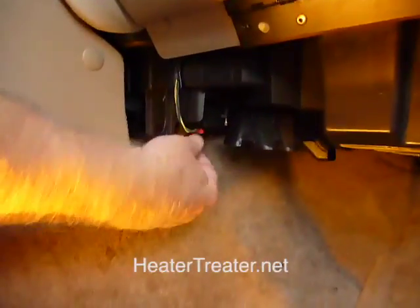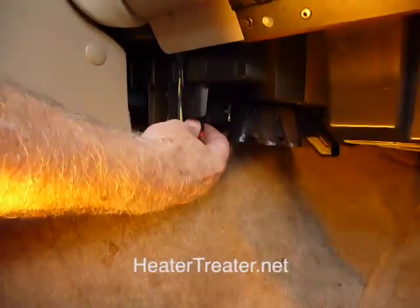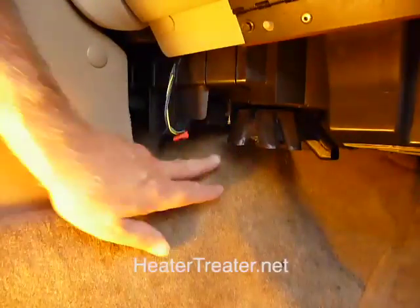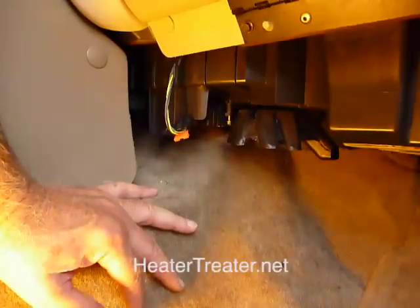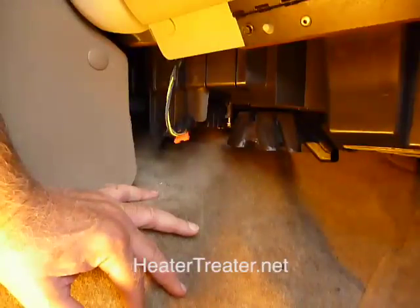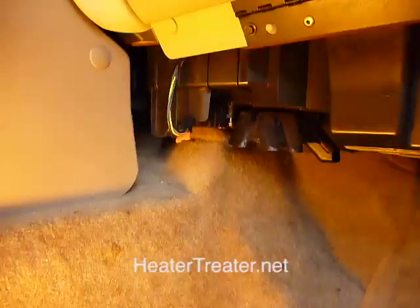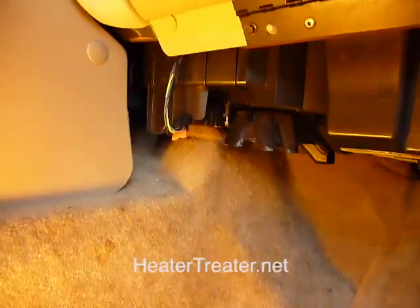The first thing we're going to do is remove the little wire here. There's a little black tab on the front of that — you push that and just pull down. Then we've got two screws; this is the little actuator motor holding it in place. I've got one kind of partially pulled down so you can see it. We'll take that screw out and the other one. Those screws are not easy to get to, so you're going to have to feel around, but you will be able to get that.